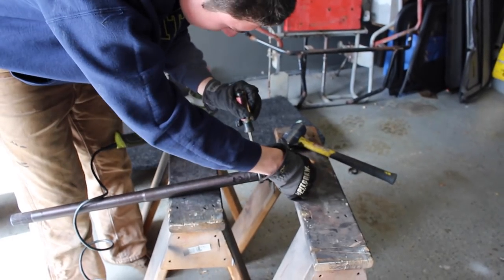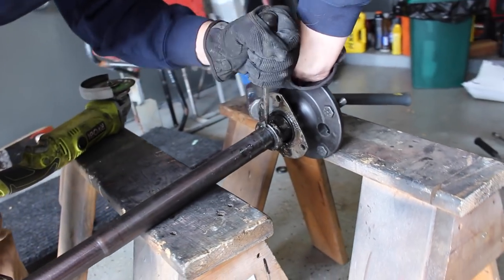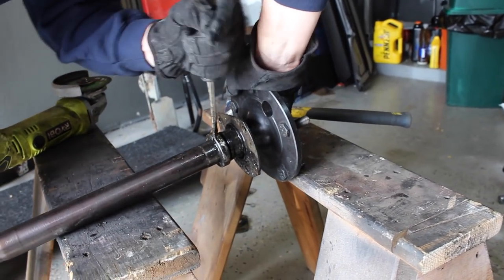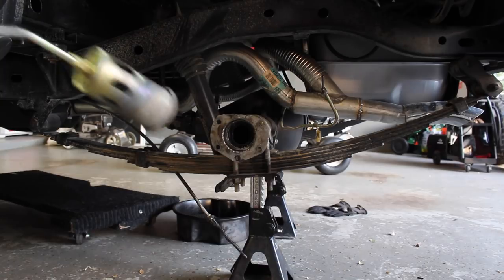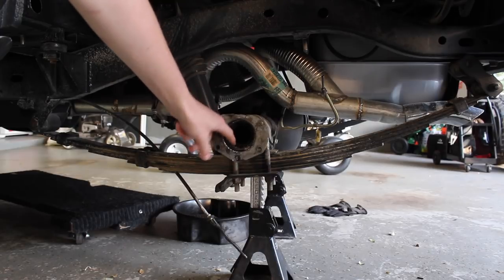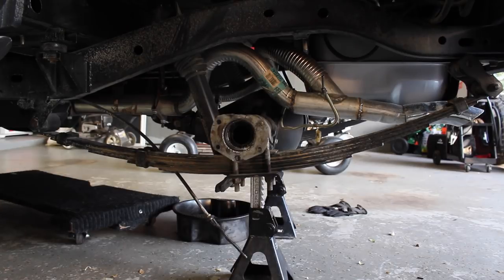I had the shaft a little bit there, but let's see if it'll come apart. There we go. Now what I gotta do is keep bringing this down. Alright guys, I got my Harbor Freight flamethrower, and I'm gonna use it because, as you can see, I have messed up the edges here and the inside of the bearing, and this isn't gonna come out without some heat. I've been messing with it for a while, and I'm just gonna make it red hot and hammer on it until it comes out, so it should be interesting.